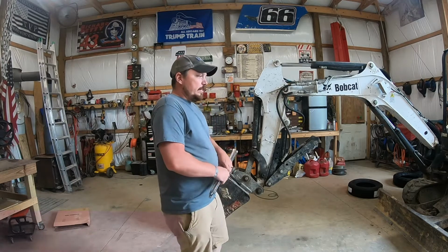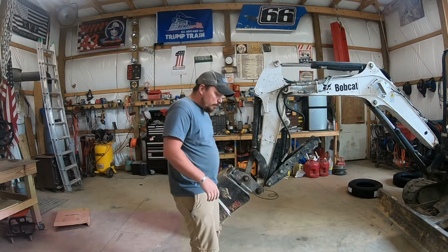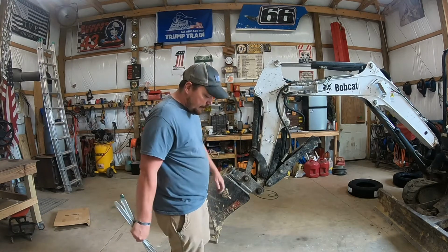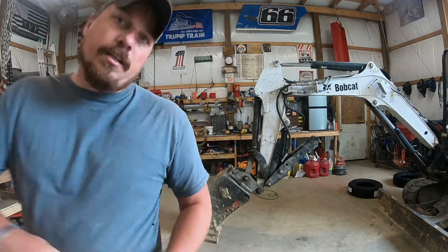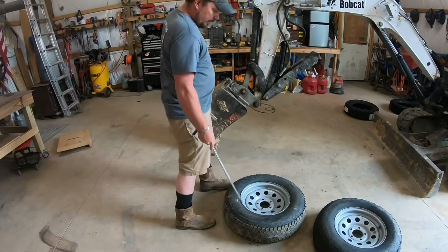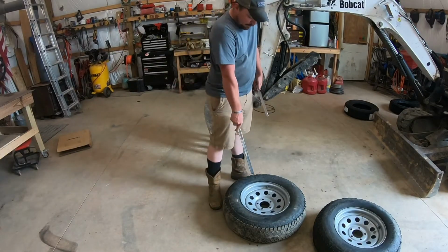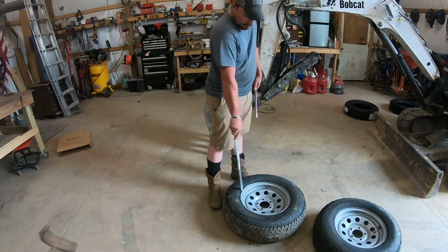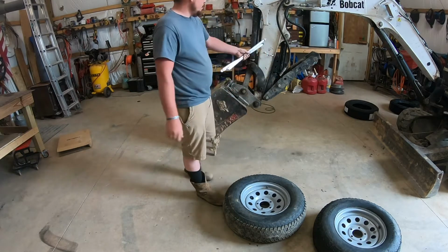Now, the first thing that I'm going to cheat on that you might not have at home is a way to break the bead. The way I've always broke a bead is take a vehicle and drive around the edge of the bead. Deflate this, lay it on the ground, and run a vehicle up on it and curve in. A lot of times it'll break that bead. Me, I'm going to cheat and use an excavator.